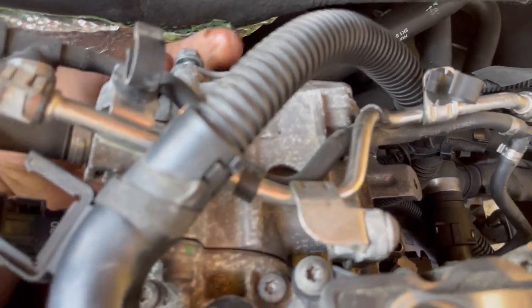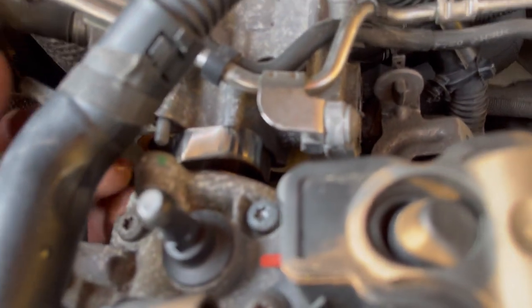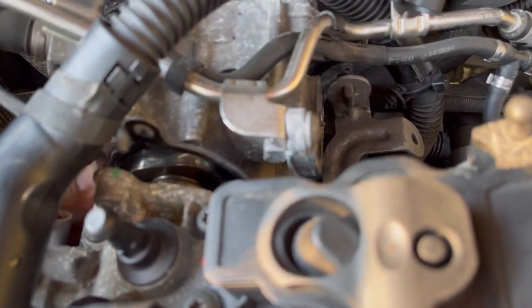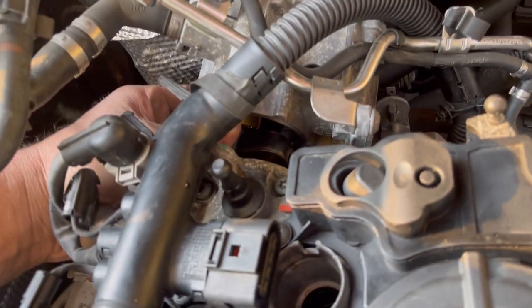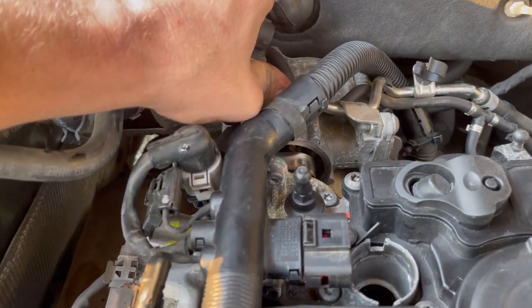I screwed this one back in and forgot all about it. You could take this bottom one all the way out — you might as well, because it could fall out and then you'd be in bad shape. And then just like that it came right off. Now what we do is we peel the gasket off right here. I just peeled it off the back of the cylinder head. You're just going to have to slide it through like that — it just fell and hit the ground. Grab the new gasket, pull it out. You don't need to put any silicone or anything on it. It fits just like this, goes on like that — you'll have to stick it in there. Take one hand and push the vacuum pump back, then slide it on.